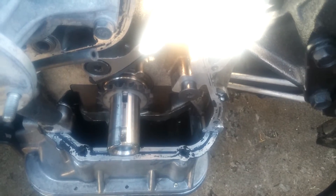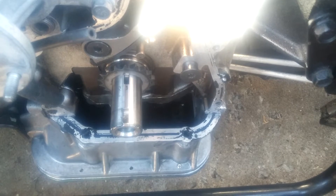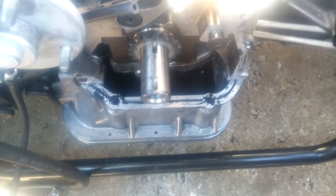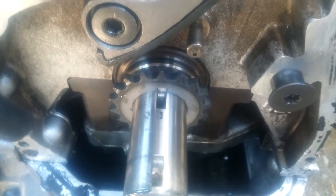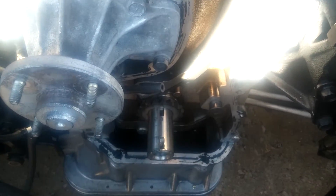We've got the gear on the crank. Like I said, it slides on either way, but you just line up the little slot with the little keyway on the crank. Then you want to install this little Woodruff key - you just want to install it in this little slot right here. There's no orientation as to which way it goes - actually it goes in with the flat side up. You just slide it in there with a little scoop motion, scoot down and slip. There's nothing hard about that.